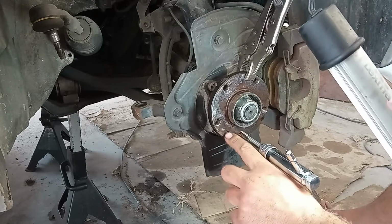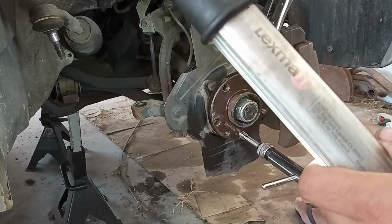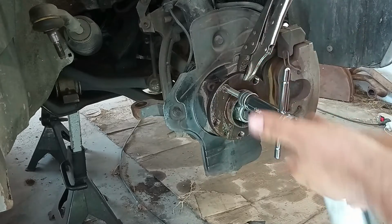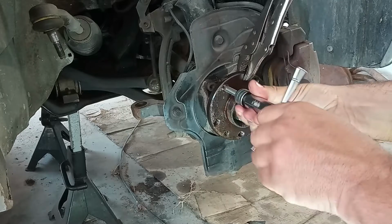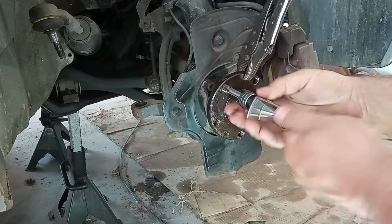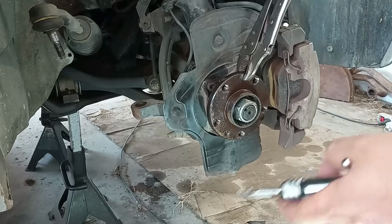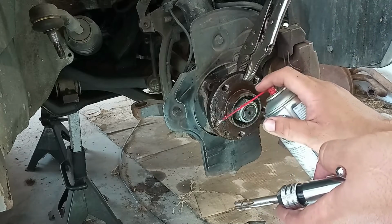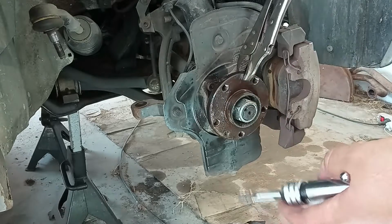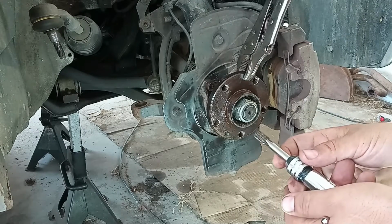On this hole over here, I have to do a helicoil repair, for example. I'm waiting for that tool to arrive. With this, surely the bolt will go in, but it does not mean that it will hold the force. I will have to test it to make sure it is okay, but I believe it is. At least it is way better.